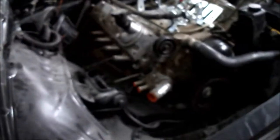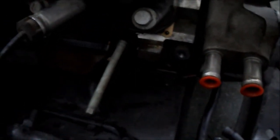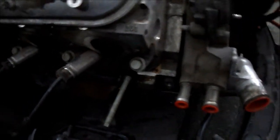I come down here, you see this bolt hole, it doesn't line up, but the other side, it does. That's the bolt that's all the way through. So what we're finding out is a lot of guys have had to make a spacer plate on each side, to bring the motor mount about another half inch out on both sides away from the plate, because it's about 3/4 of an inch away. And even then, you may have to elongate the bolt hole just a little bit to get it to drop down in there. So we're willing to do it.